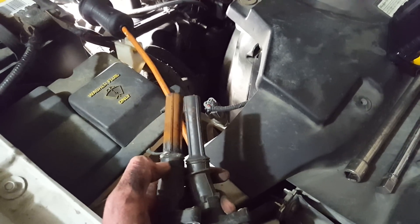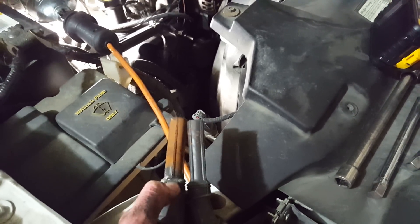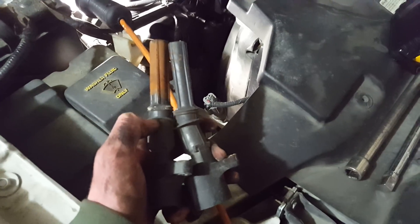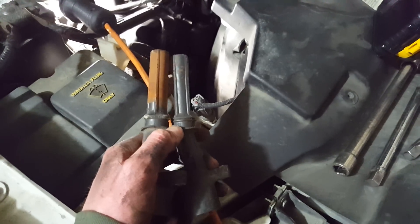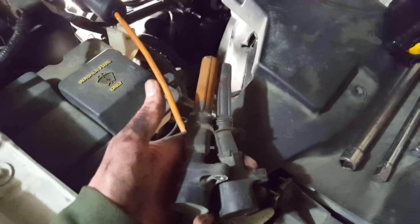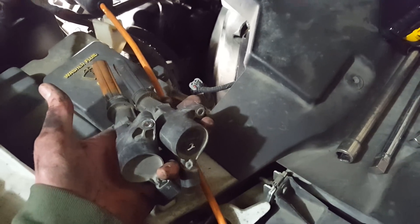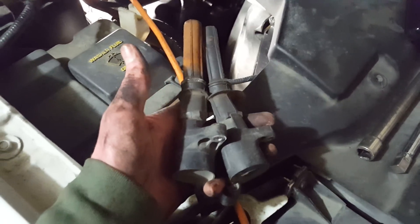I would recommend blowing out the moisture first. You can even pull the spark plugs — the manual says to just re-gap them. If they don't look too bad and aren't too old or high-mileage, you might just want to try that. If you have moisture causing the misfire, try cleaning it out and just trying it again. Maybe swap a plug just to make sure you don't have a troublesome plug and see if the fault follows. Otherwise, that should be good. Obviously you don't want to spend money if you don't have to — no reason to waste money when you've got parts on the vehicle that are interchangeable. Go that route first.